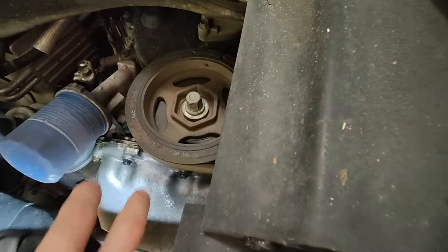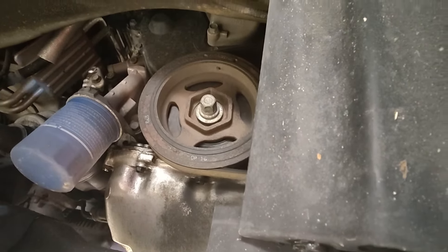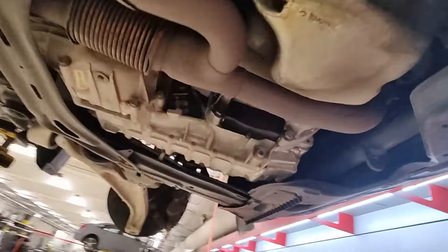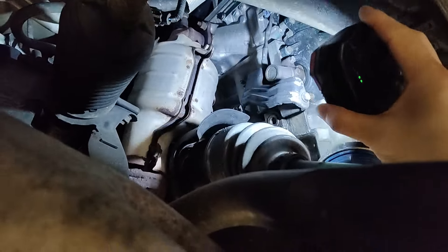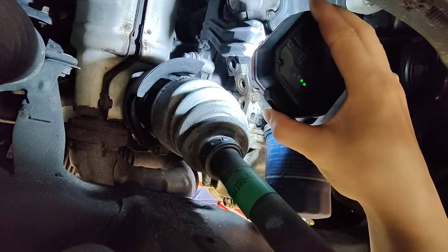Other than that, check for oil leaks. Your usual suspect is the oil pump seal leaking, or in the case of this one, the oil filter housing is leaking oil. Right here, you look above the oil filter housing — it's dry above and then it just starts leaking right over here. That's where that oil leak is coming from.